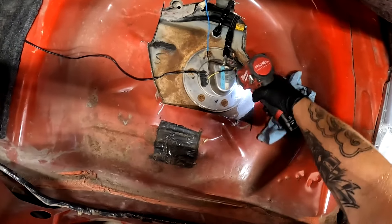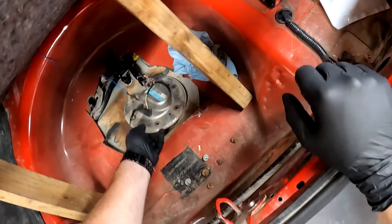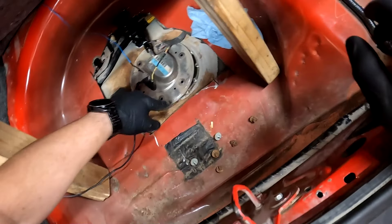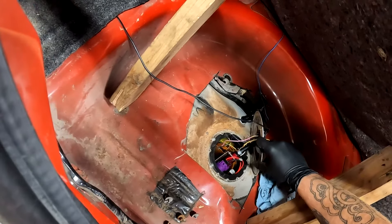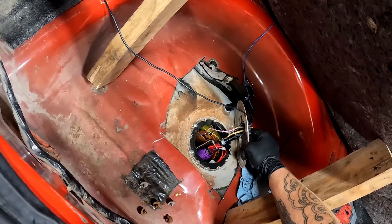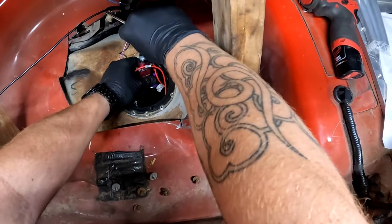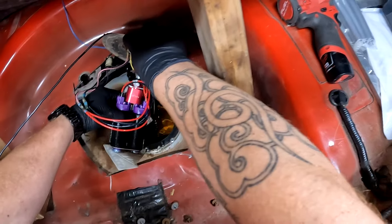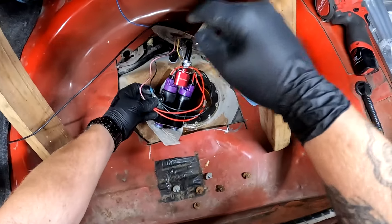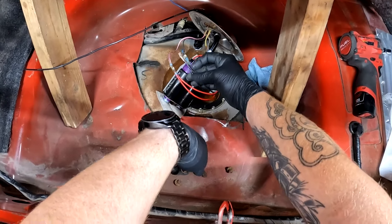Let's take the carpet out - it's so easy to get to. All those are unhooked so I should be able to pop this up. I'm really hoping one of the connections here is just bad. Nothing looks broken. Let's go ahead and pull this whole mechanism out - Racetronic fuel pumps. Well, that might be one problem right here - the ground's off.